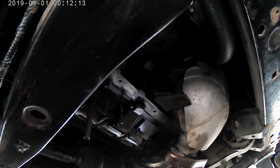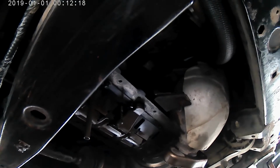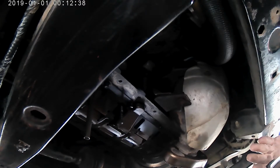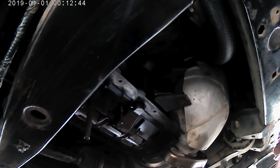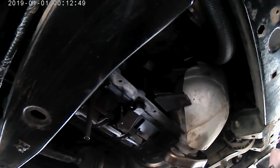cure. That is one thing that you guys need to do if you're going to use RTV sealant to seal anything. Before you try to run the engine or put oil in it, let that RTV sealant set up. If you don't, the pressure that builds up inside your engine, every engine builds pressure. You've got oil pressure, you've got coolant pressure, and obviously you've got your air-fuel compression.